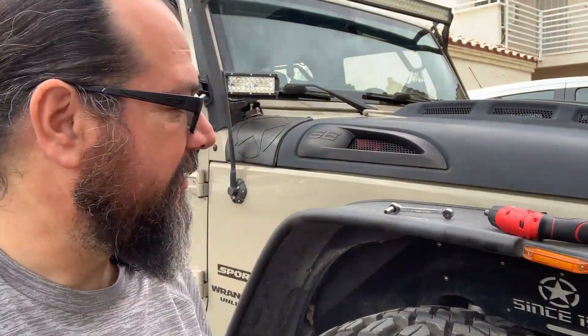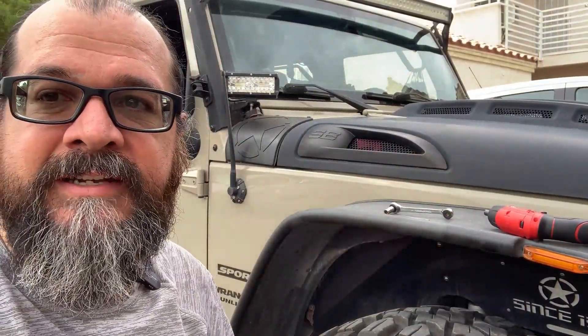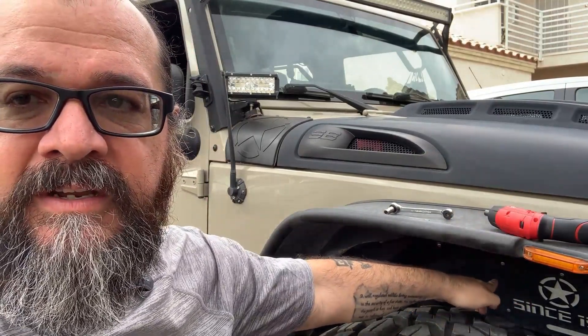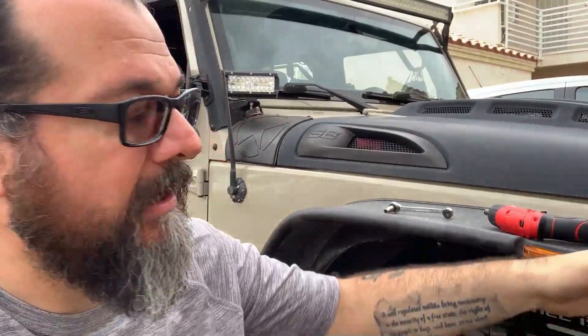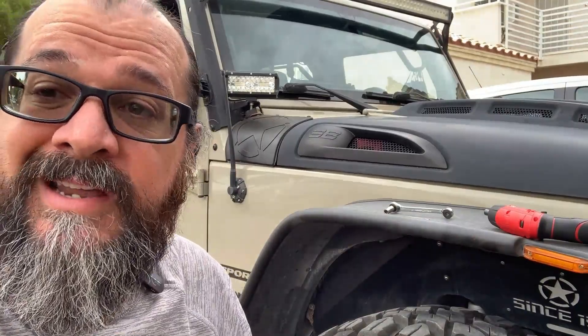So this is where we're at right now — we're at the side of the vehicle. What we're going to do is actually remove this fender and remove this inner fender liner. We're taking this method because going under the hood, there's a lot of equipment in the way and we really can't see the wiring harness from that side. In most cases you'd remove the grill, but in this case I can't because I've got that 12,000 pound winch in the way.